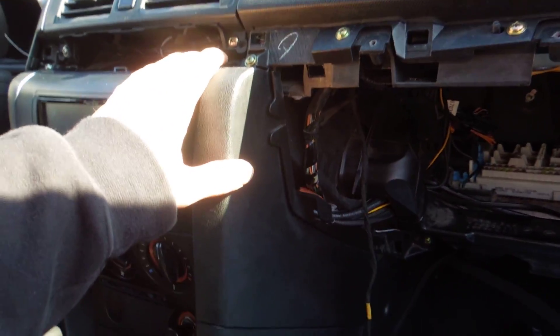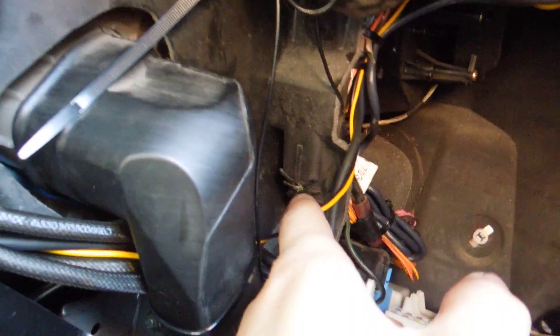Once the glove box is out of the way, if you have this radio, you can hide the one wire going to the module by running it through the radio cavity or through the opening in the back. If you have the older tuner, as you can see, I've got all my wiring running through here — the power, ground, and iBus cable going to the first module, which is hidden over here secured with a zap strap. Then it goes to the tuner up here.